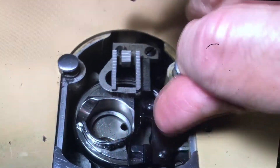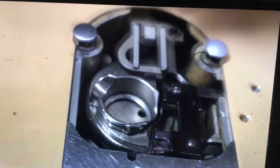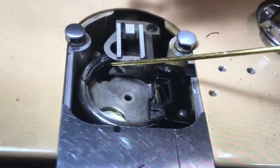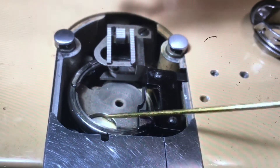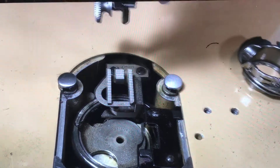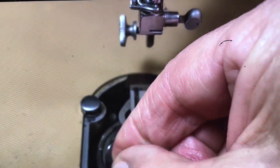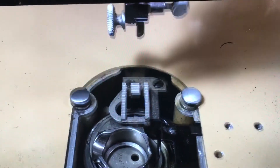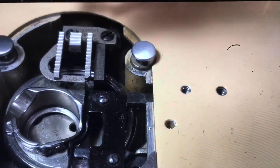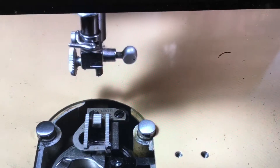You can take it apart, clear it, clean it, oil it, and put it back in — but if you don't fix that groove, the very first stitch will lock it right back down. You have to get that notch out so the thread will slide through that thread gap. Always, with any of these machines — metal or plastic bobbin — oil around the circumference of the hook. Put a drop on the right-hand side, away from the bobbin case, away from the tension area.